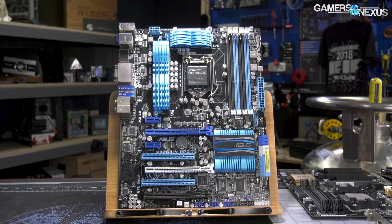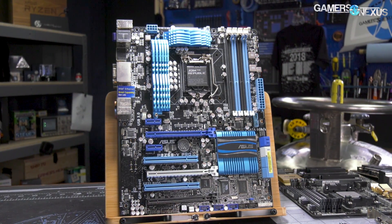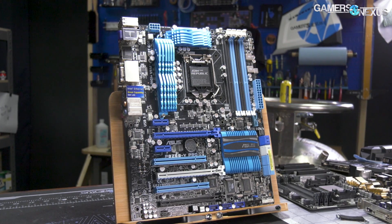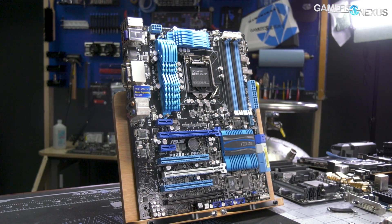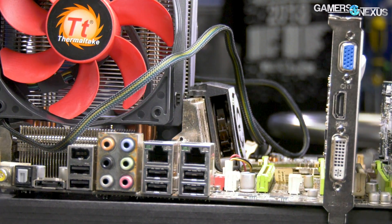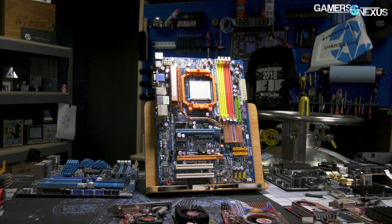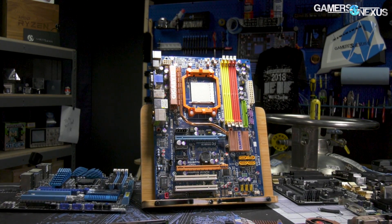The only motherboard with PCI slots we've used in normal benchmarks lately is the ASUS P8 Z68-V Pro, used for testing our 2500K and 2600K Intel CPUs. Unfortunately this board wouldn't POST with the PCI card connected, and neither would the nearly identical P8 P67 Deluxe sent in by GN Discord moderator Liquid Paper. We then tried more boards from viewers. The EVGA 790i FTW was promising but damage to the CPU socket meant it constantly reset BIOS settings, preventing selection of PCI cards as the primary display.